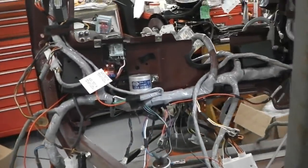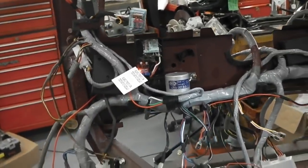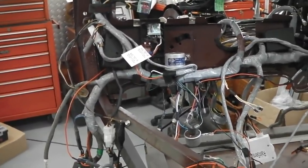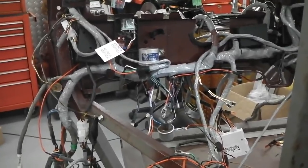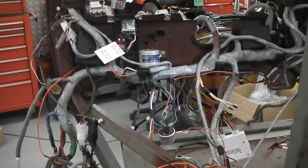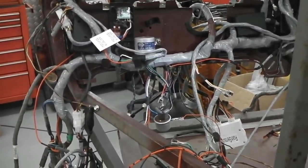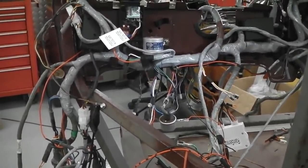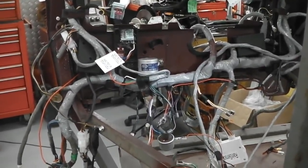I wrap sellotape around them because they tend to unpeel otherwise. I think they're like an Evo-Stik type glue that held those on in the factory, like a brown glue. You see it when you're unpicking your wiring looms. Sort of slightly light tan colour of glue that they use to put the labels on. We haven't got that type of glue. I just wrap sellotape round and they're fine. And quality sellotape, not the stuff that breaks down over time, the decent stuff. That's it. Someone's going to suggest an adhesive that'll work, aren't they? Hazards then. Nice. Time for another job. Let's move on.